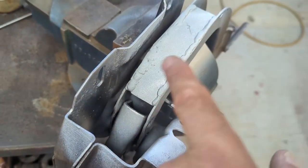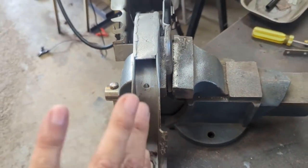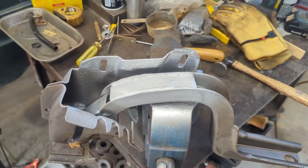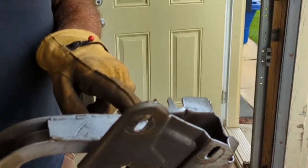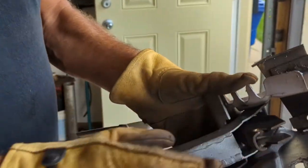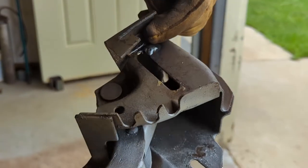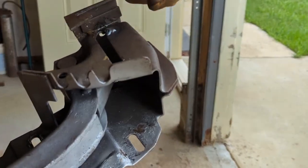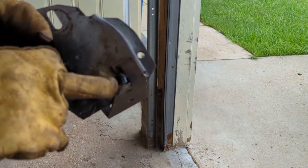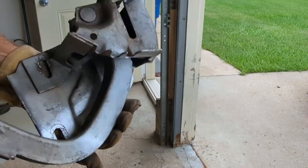She's all boxed in — I just gave it a quick rub with a grinding wheel. This isn't very visible; it's underneath, and this hinge flips over so this will be at the bottom. I welded up the back side of the hinge, put it into the car, and it was still binding on this mechanism right here — binding on the torsion bar. I noticed up here it was worn quite a bit, so I put some weld in and gave it a grind with a die grinder on both sides. Now I've got to bend this tab back down, put it back in the car, and see if that helped bring the torsion spring forward so it doesn't bind.